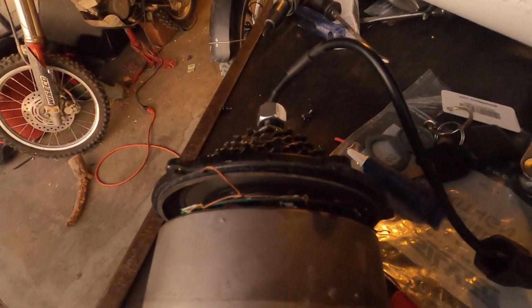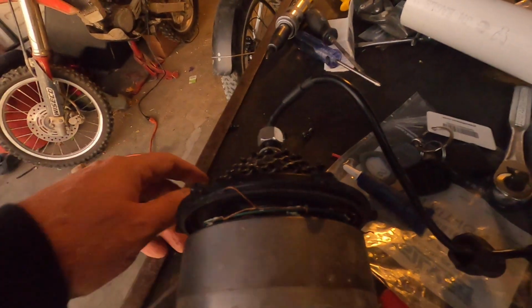The other oddity was there's this little rope or this little wire that sort of ties the PC board, this is the PC board, onto the windings, and that came undone too. So I don't know if that failed and then the board separated off of these 3 connectors, or vice versa. But in any event, it looks like it was just simply a PC board connection failure off the windings, and that's why the motor failed. So there's a quick recap of what happened.